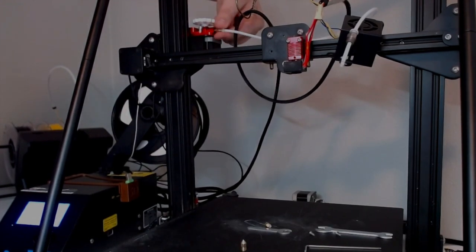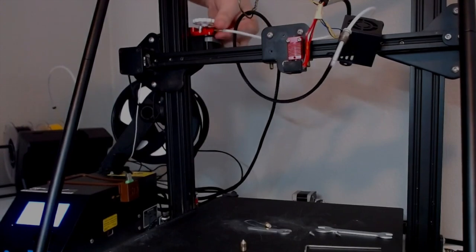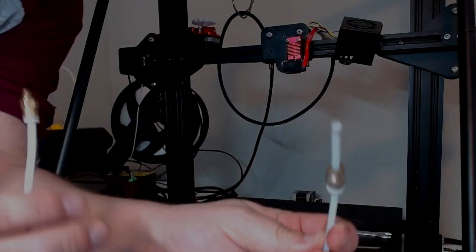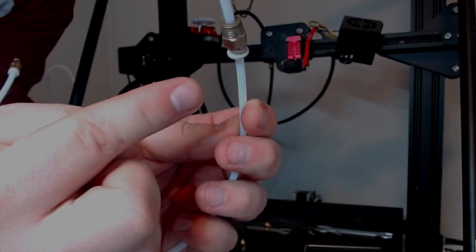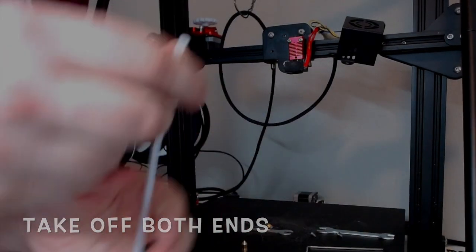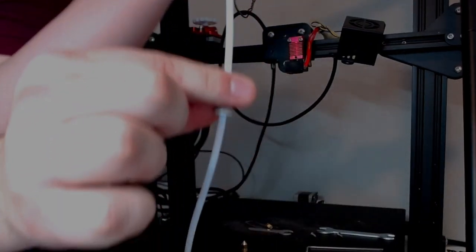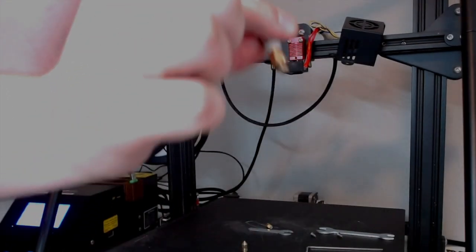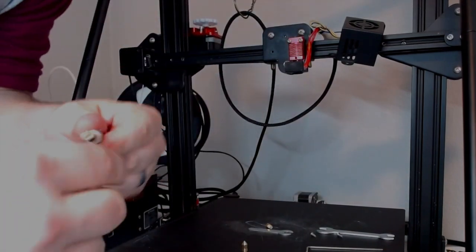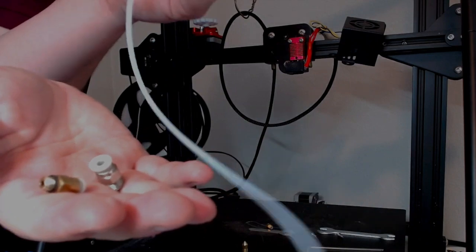You're going to completely take this tube out. So if it's taped to that black wire there, then you need to just remove it. Take these 2 pieces off the whole Bowden tube because you're going to use it and reset it. Pull, don't push. It only goes one way. And then that same other one is going to pop off too. So you'll see pop, and then the other one pops off, and there you go.